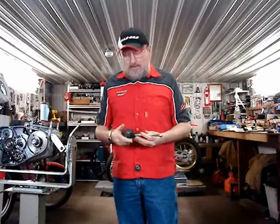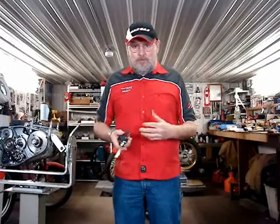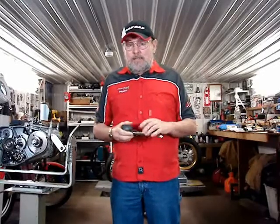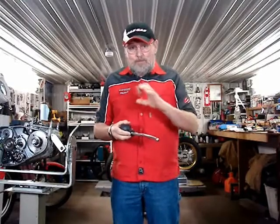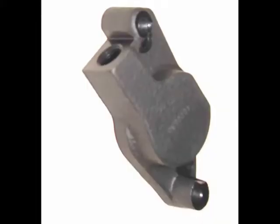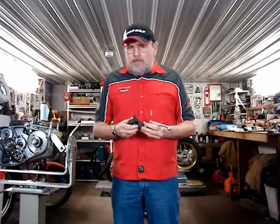After all this about the clutch itself, I have to tell you that there are really three things that make a clutch operate perfectly. So I need to cover the other two quickly. One is the slave cylinder on the side of the engine. Basically, it is good or it's bad. There's a rebuild kit or you replace the whole thing when it's worn out. It's not a commonly worn part, but on an older engine, it's possible that may go bad. Typically, when that fails, you have hydraulic fluid from the system leaking out through the O-rings around the piston. Or it can have some wear in the bore, causing that piston to hang up or drag. That's a pretty simple part.